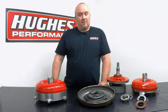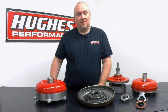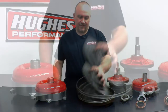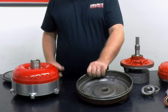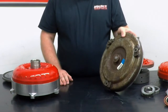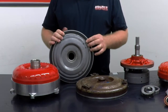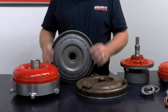Of course people wanted to modify their vehicles even though we're dealing with more stringent emission standards and fuel saving devices. Horsepower is more available today than it's ever been, which has required the aftermarket to respond with stronger lockup torque converters featuring better friction materials on the lining, billet or forged pistons, and when necessary a forged steel or billet steel cover to replace the factory steel stamping. On some stampings — not all — they are prone to flex when the lockup applies, and the cover can actually crack over time, or you can experience premature failure of the lockup lining from cover flex because it won't have 100% surface area engagement.